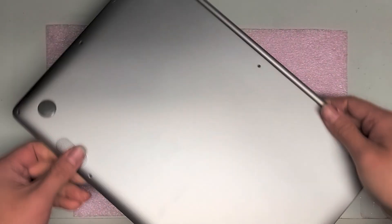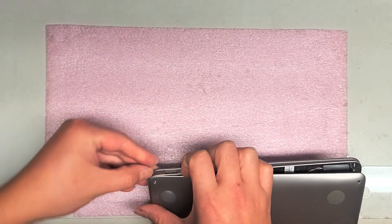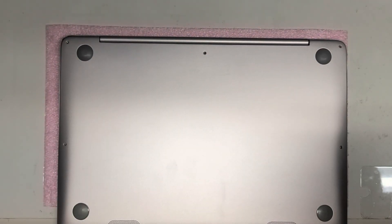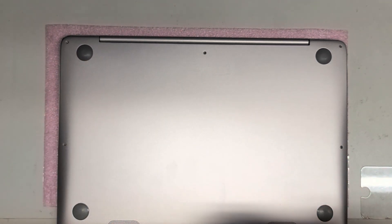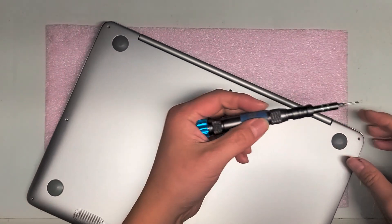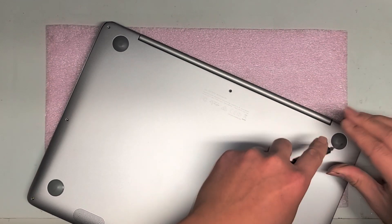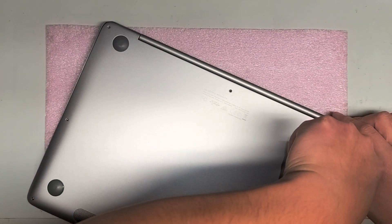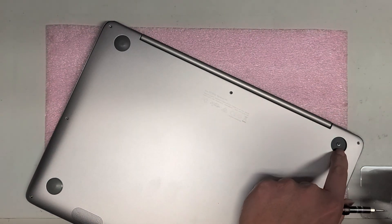So I'm guessing I'm going to have to remove the rubber feet. I'll try a little bit — I don't want to pull too hard. It doesn't seem like it'll come out, so I'm going to try and pry up the rubber feet. To do that, I'm just going to get a small flathead screwdriver. This can be a little risky because it can scratch up the cover. And there we go — there is a screw under there.